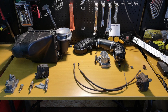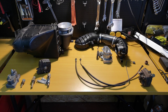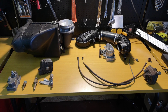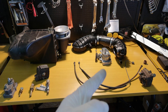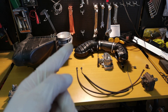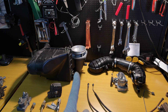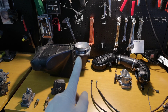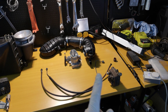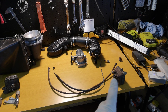Hello. In today's video I want to take you through the basics of a Bosch K-Jetronic injection system in a Porsche 924. Let me jump right to it and start with the throttle body. The throttle body is connected via this intake pipe with this measuring unit. This measuring unit has a measuring flap, and these are the metering blocks — one for the Porsche, this one for the GTI Golf.